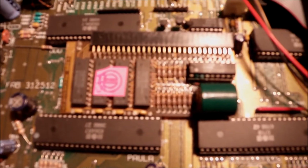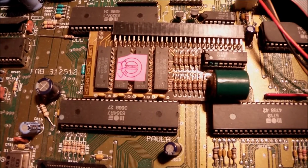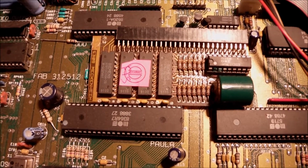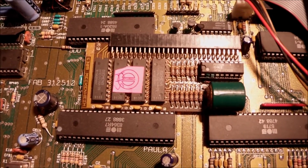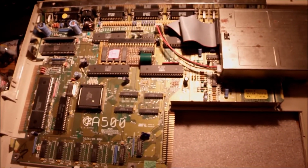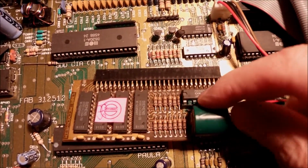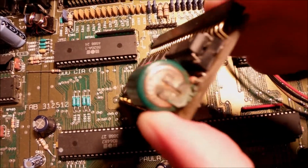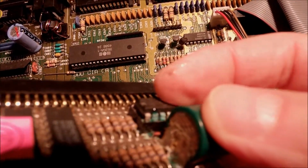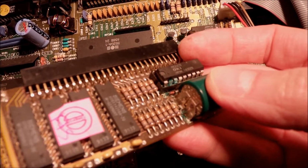And I think this Amiga comes with many surprises. Now, what is this thing doing in between the shield and the motherboard, placed carefully among the chips? This is a module, if I'm not mistaken, with a battery holding the real-time clock, and again, it shouldn't have been there in the first place because it's a module, and I think, yeah, it has mold, like really has mold onto the chip coming from the battery and around the circuit.